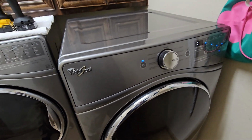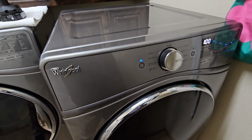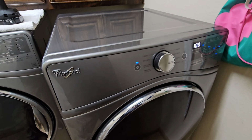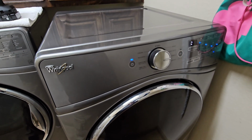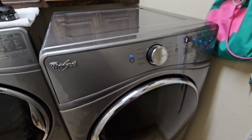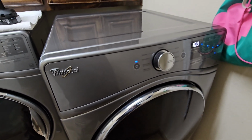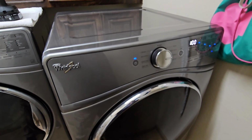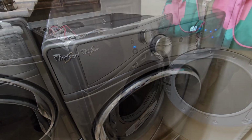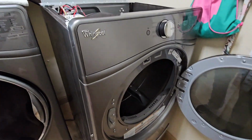And it's coming in right about 70 to 72 decibels. It should be between 60 and 65 decibels, right around there. So we're going to put a new motor in, and I'll put a link to the motor on Amazon, and a new blower fan blade as well. So check that out. Okay, so this is a pretty straightforward job to replace the motor and the blower, right?